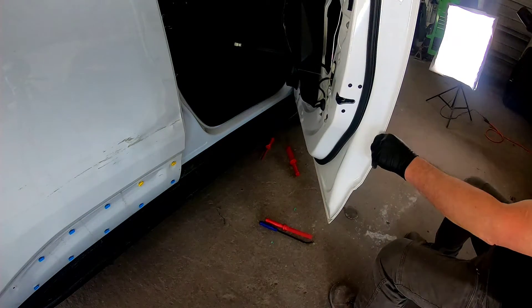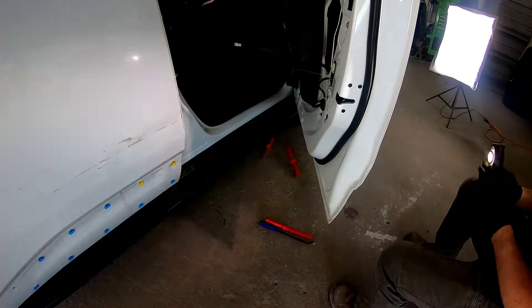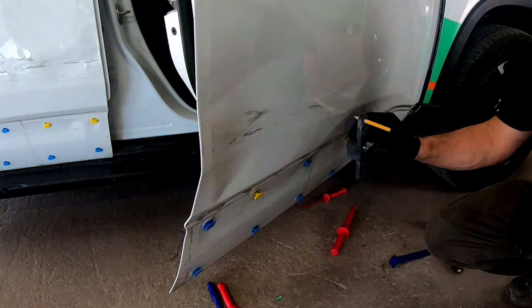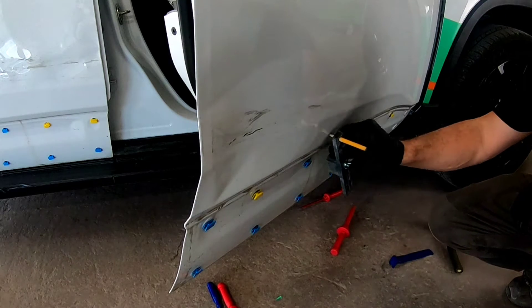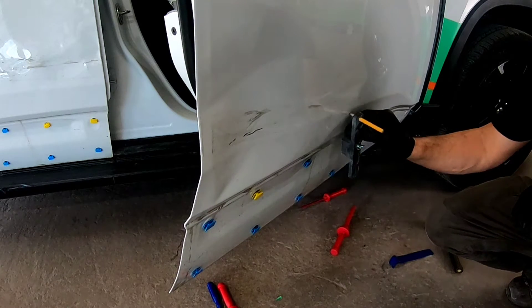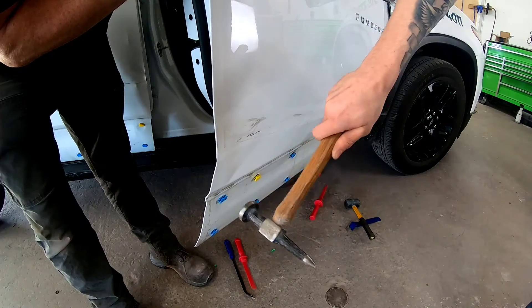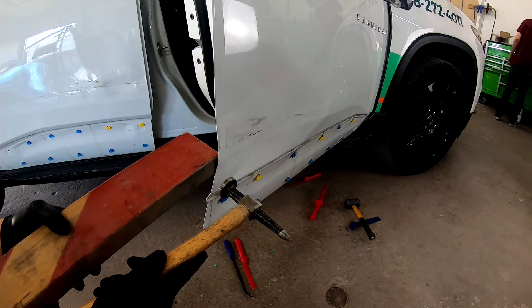There are braces inside these doors, so some of this dent is covered by those braces. We'll have to either get back behind those or do some welding with the G90E to pull those dents out. The impact in the center created a crown right where I'm marking with that pencil, and it also pushed out the edge of the door here. So what we need to do is straighten up that edge of the door a little bit, put pressure on that low area where the impact occurred, and knock down these crowns. I'm applying a little pressure in the center of that large dent and Darius is going to tap down the edge of this door.